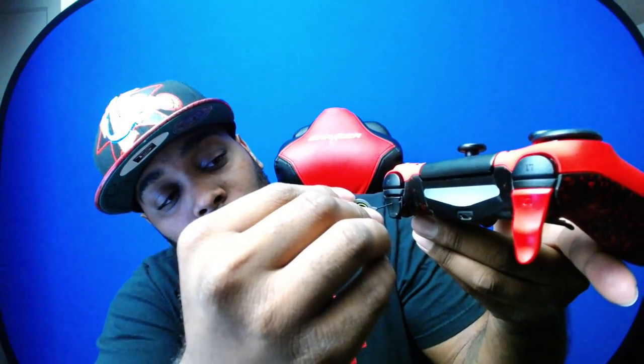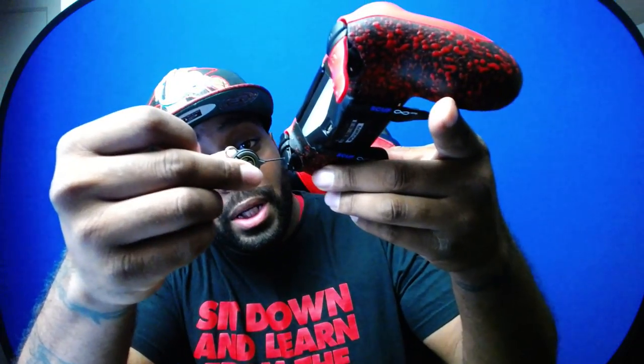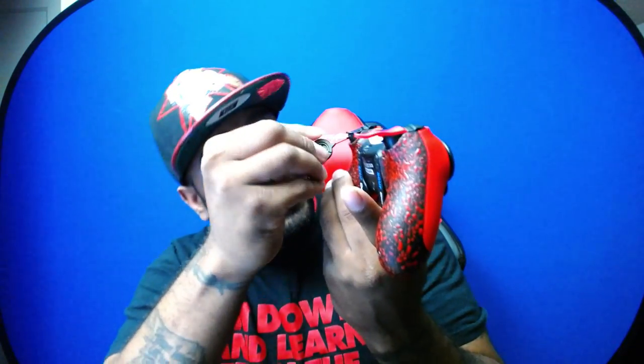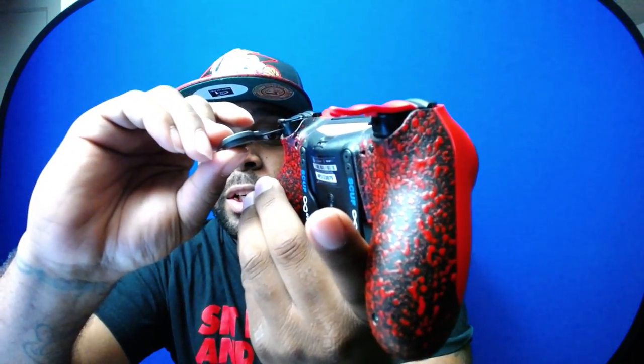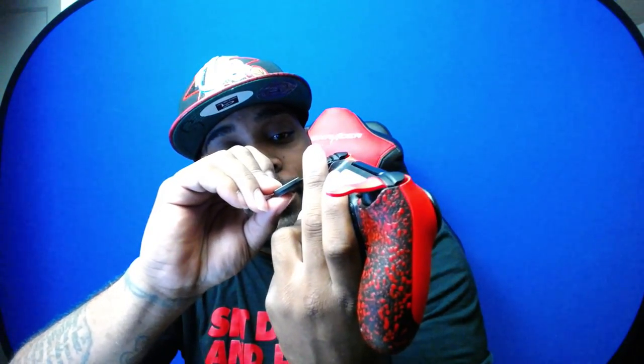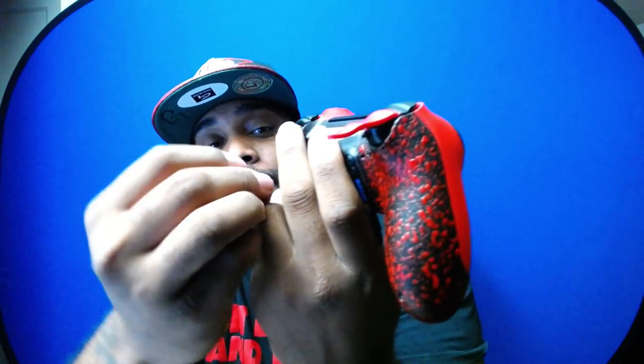The R2 and L2 are clip-ons — you can take them off. Let me go ahead and pull them off — see that, the extendo is on. Before I put on a hair trigger: what you have here is the sweet spot inside your controller. You can put this in and tune it — tune how much give it has, as well as how far you want your R2 to travel down. Right now if I press it, the R2 doesn't go down that far. If I turn it again, you can press it fully down. If I put it back and turn it the other way, this is how it came standard — it goes about halfway down. Now I'm going to put on the short R2 and L2 versions to show what those look like snapped on.